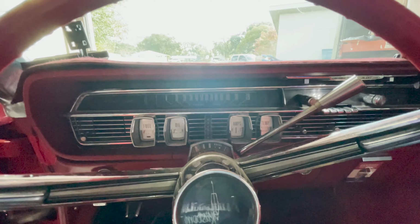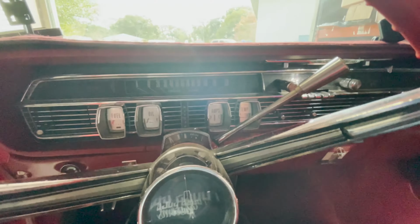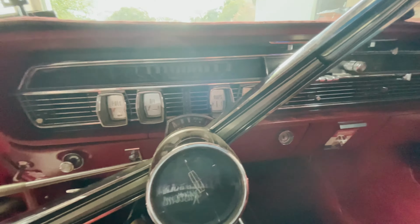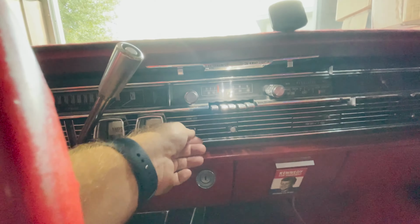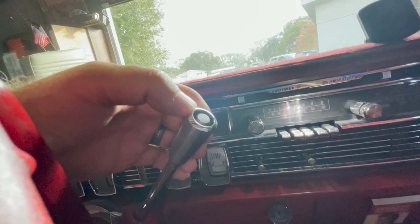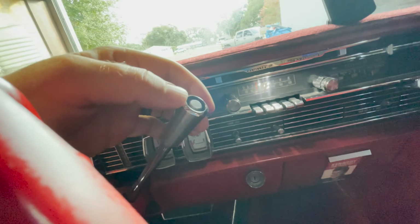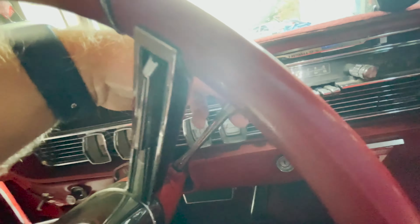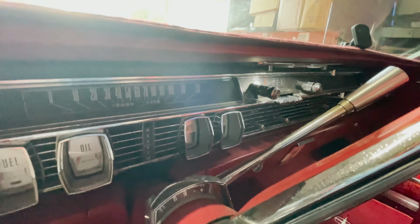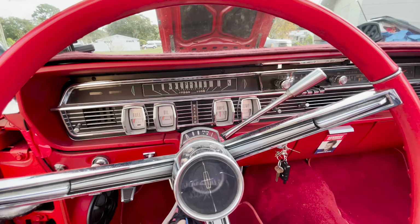Okay, this is before I moved the car, or before I started the car. The car's been sitting now for a week or two, and as you can imagine, the vacuum is going to leak out over time. It's kind of like the door. I don't use the door lock feature, but from what I understand, this is going to leak out over time. So, for instance, here's the button. You can hear that clicking, hopefully. That's the solenoid. Of course, it's not going to do anything because there's no reservoir right now. So I wanted you to have an example of before the car's been started, before the reservoir tank is full. Okay, so that's the before.